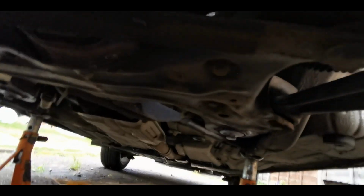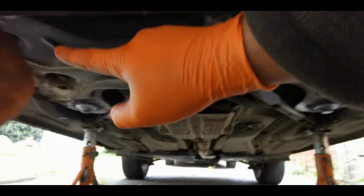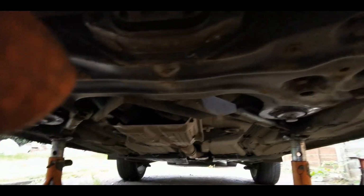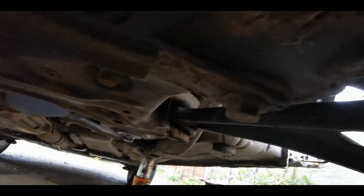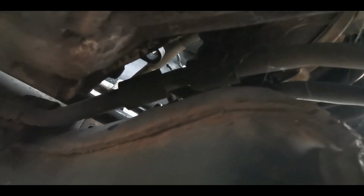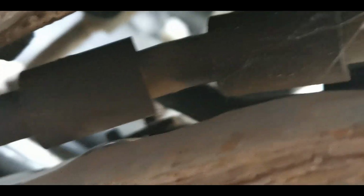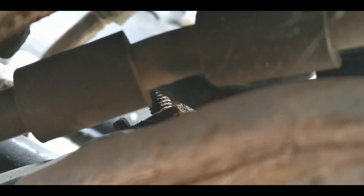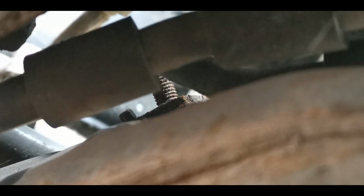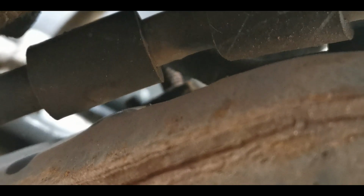So then we're going to have to remove these 4 bolts here, which go through into the steering rack. We can just about see, it's not on this one, but just through that gap there, you can see that threaded fitment there that's on the anti-roll bar bracket. That's usually got a P-clip that sits around this power steering line and holds it in place to stop it moving. So that, you usually tend to undo.